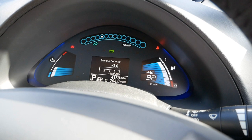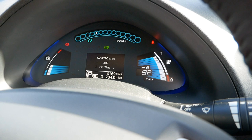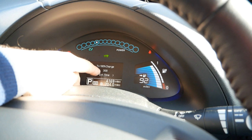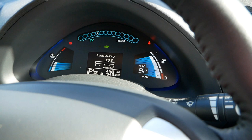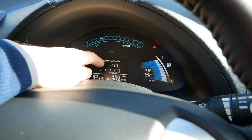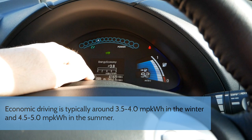Using the buttons you can change what's displayed on the middle screen. I can see it says 80% there, confirming the battery is currently at 80% capacity — we've lost 20%. Scrolling through, you can see various trip and settings information. There's the predicted time to return the battery to 100% if plugged in — it's saying three hours, though that can be inaccurate too. There's also your average economy — we're showing 3.8 miles per kilowatt hour here, which isn't particularly economical but it's the middle of winter. On electric cars, economy is measured in miles per kilowatt hour — the equivalent of miles per gallon on a petrol car.